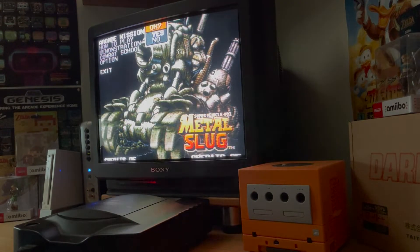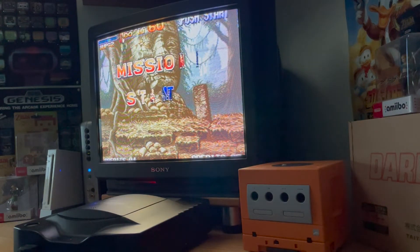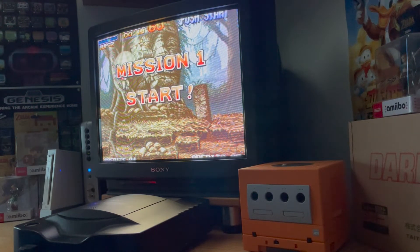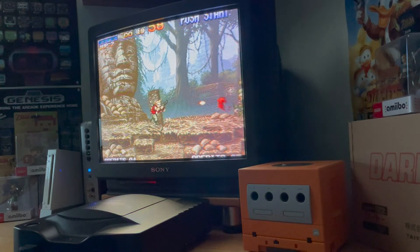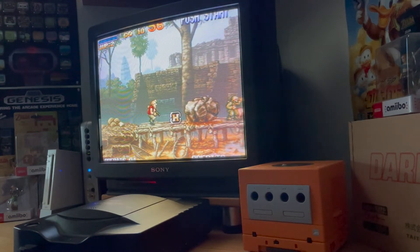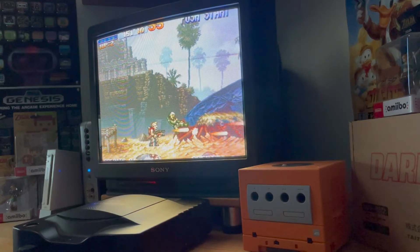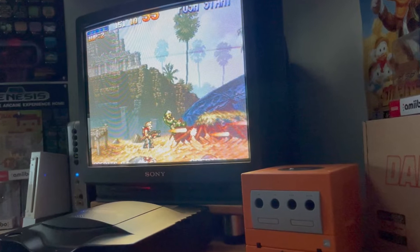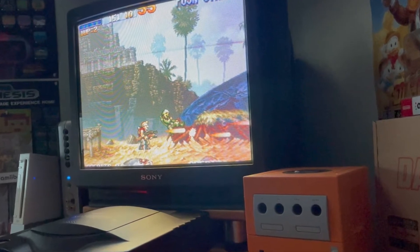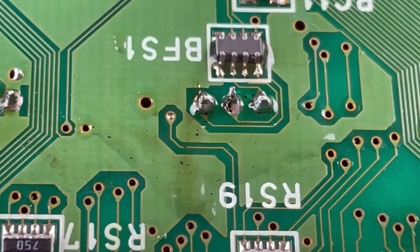While we wait, just to note that the load time is pretty insane, don't you think? Excuse the audio here — I've had to record it straight off the telly. See the problem yet? That's right — there's no gun noise. In fact there are no sound effects whatsoever, only music. Thanks to some helpful people online, I traced the fault to a short between the RF shielding at the bottom and the underside of the motherboard where I'd connected the audio wires. But once I put it back together I then discovered a new problem.